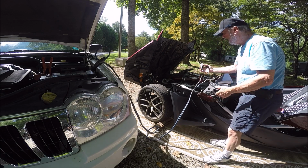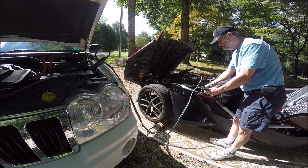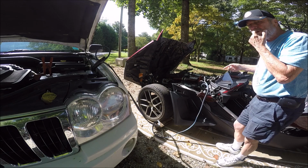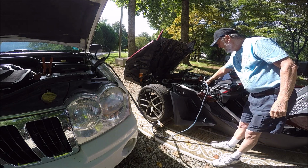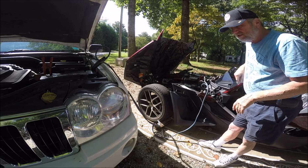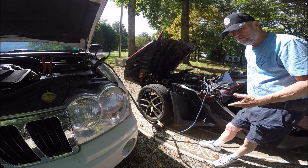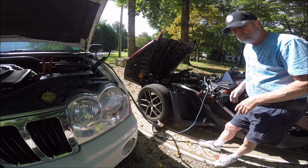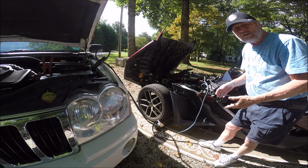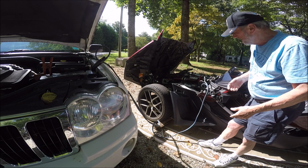So make sure that that's stable and you don't pull it, and you got a good connection there. And then we're going to connect this to ground. Right here is a good ground, your latch. So we can put this here. And we're 11.8 volts right now, 11.9. Here's what I suggest. This is a very small motorcycle style battery that we have in our Slingshots. And they're that way for weight, to meet the requirements of weight for the Slingshot to classify as a motorcycle.